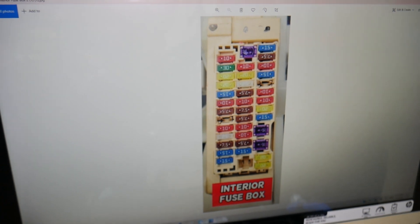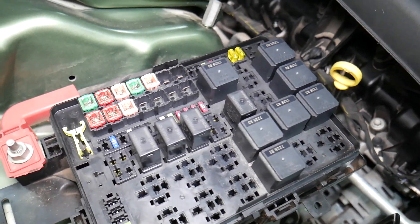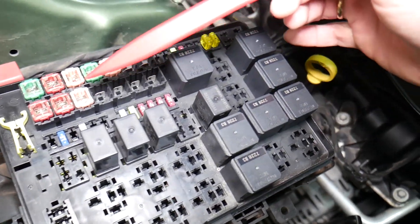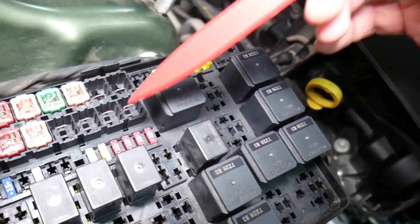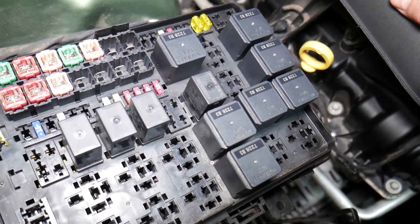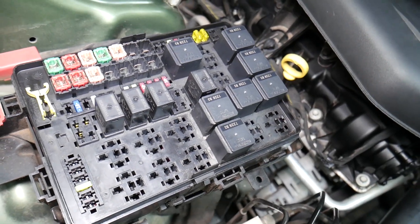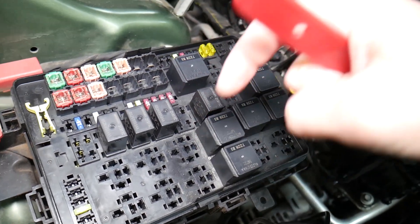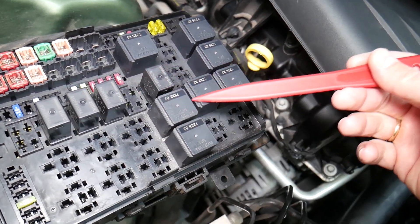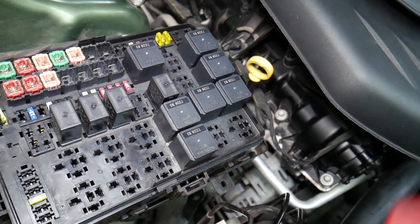Before we continue, let's explain quickly why it's always a good idea to test fuses and relays. It is super important to always test fuses and relays — and here's a common mistake people make. Sometimes you may think a fuse is good, or you cannot actually see if the fuse is clearly burned. In that case, you may put the fuse back and end up spending money and time on parts you don't need. All you have to do is just test the fuse. We'll put a link in the description below on how to test fuses — it takes only a few seconds to find out for sure if it's good or bad. The same thing for relays, and we'll put a link below on how to test those as well.